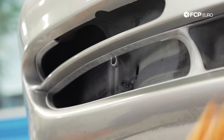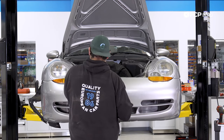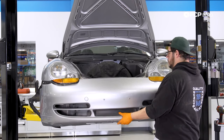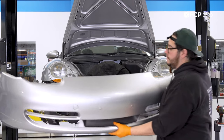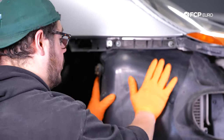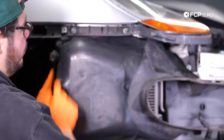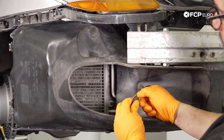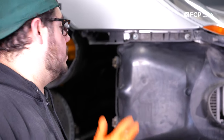Now we're ready to remove our bumper cover, and this will tell us if we missed any hardware or not. Just like that, it's off. At this point we're ready to start getting our radiator out of the car. Before we remove this plastic shroud, we're going to disconnect the sensor. We have a couple of Torx bolts to get out of here. Press on the tab to release. Now we're ready to remove this front cover — you have a couple of T25s all around the edges.